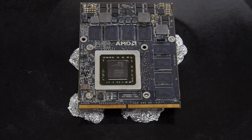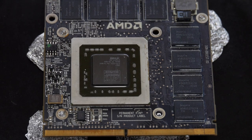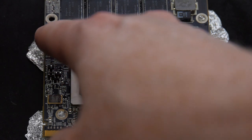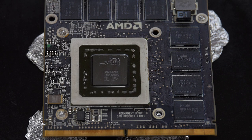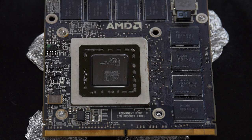And here it is, freshly baked AMD cookies, or, well, video card. Just to show you the top view, I have a pointed piece of foil here, here, here, and then at this upper right screw hole point. And I found that's the best stability to keep it that way. Even if your oven vibrates a little bit, it didn't move around. It stayed rock solid on there. And you can see kind of how far apart I had the base of each foot.